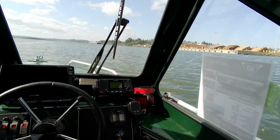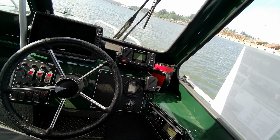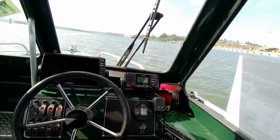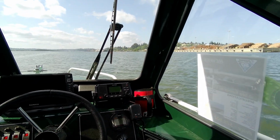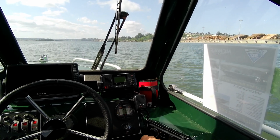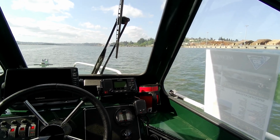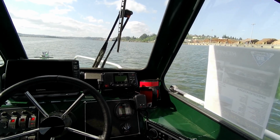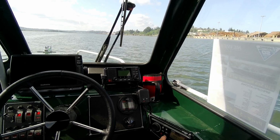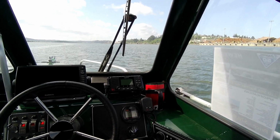Hit this one right here. That turns the radio on. You've got a USB port right here and a 3.5mm jack right there. Volume's right here. You hit this button right here, that goes into presets. That's FM. If you want it to go auto or manual, you hit this one. That goes into auto, so it'll auto search. If you hold it, it'll say manual. Then you can manually set.